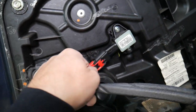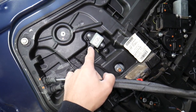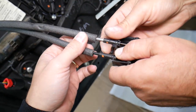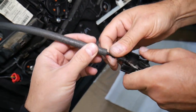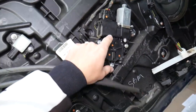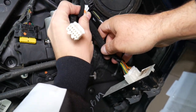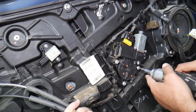The car battery has been disconnected for about one hour. Now we can go ahead — push here, pull out the clip and it comes out just like that. This sensor can just stay right here; I don't think we need to remove it. Pull the cables out of that bracket — the big one goes on top, the little one on the bottom. The window motor needs to come out right here. Press and disconnect the wiring harness. The window motor comes out with a Torx 20.